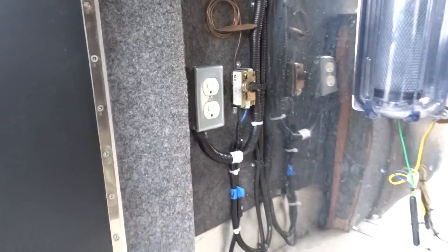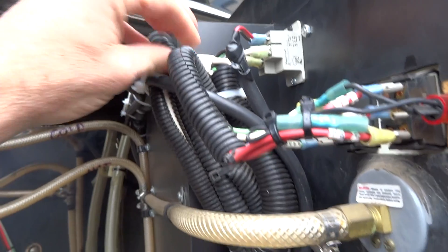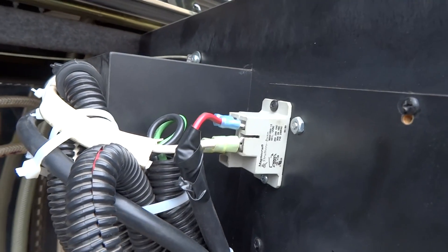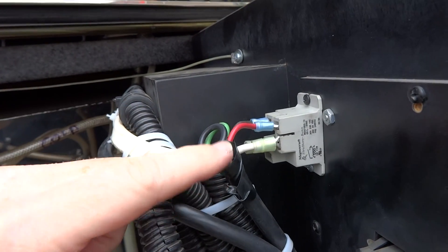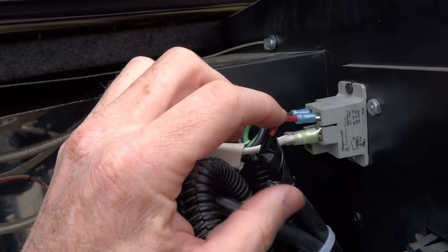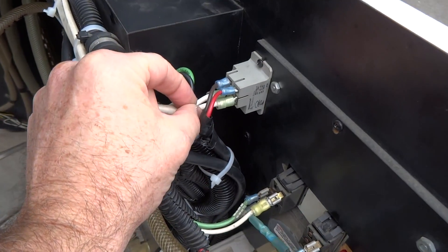In order to get this activated from the pump switch, we've got one pump switch here on the outside of the coach, and there's a pump switch on the inside of the coach as well. We had to wire it up on a relay. Here's the relay that we installed. We're running ground and positive directly to the plug, and we're breaking the neutral. The neutral is right here — it's broken and triggered by the relay. It closes as soon as it sees the 12-volt trigger signal from the switch, either inside the coach or out here. This relay will then close, connect the neutral together, and pass through the neutral over to the plug.